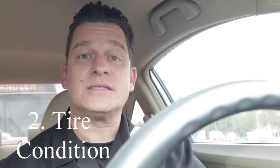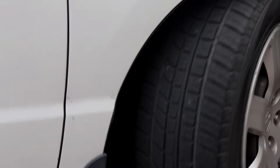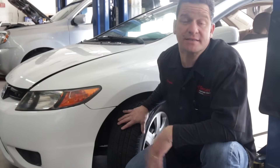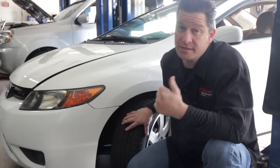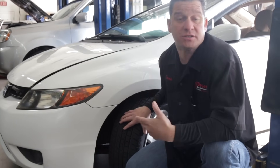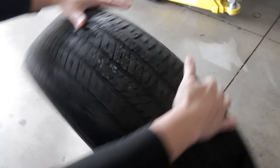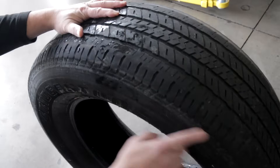During that road test, make sure you check steering, stopping, and stability. Now let's head back to the shop and examine the number two vital step — the rubber of the tires. There's so much you can tell from tires. In this case, these tires are brand new. It's always best to ask the seller for any tire warranty so you can tell when the tires were replaced and potentially carry over a warranty. As that tire rolls on the ground, there are clues to look for. If you've got some outer tread wear or inner tread wear, that's a good indication of a problem with the suspension.